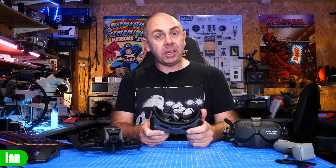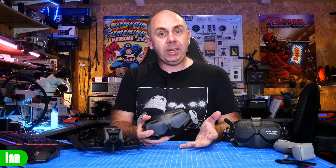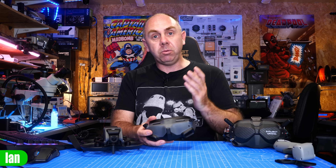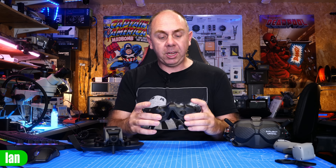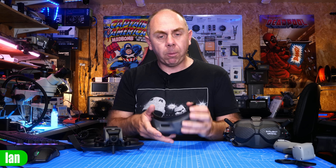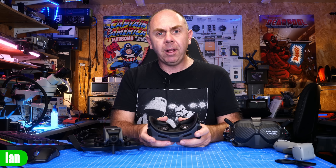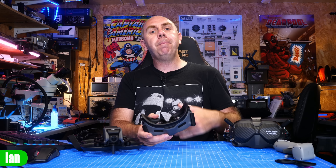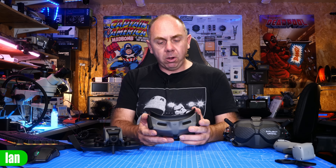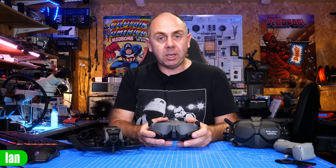As you've seen, the packaging on these goggles is quite impressive, although the design isn't great in many ways. That anti-fog issue is going to stay there — it's not going to go away. There's no way to improve it with regards to firmware. There's no ducting, and basically all they're doing is taking air in from the bottom and blasting it out the top. We need air blowing over the lenses, not sucking in, to remove the fogging. So it is an oversight in my opinion by DJI — the way they have designed these goggles — and simply the fogging behavior just isn't good.